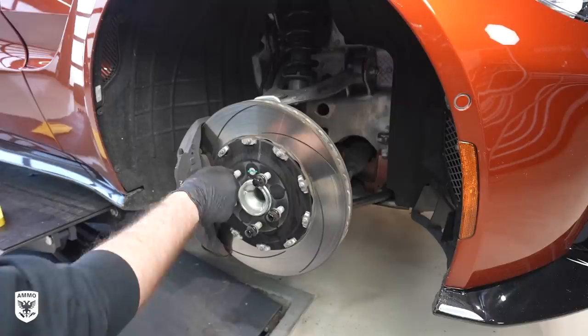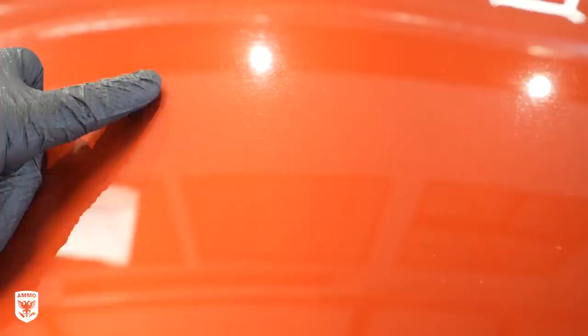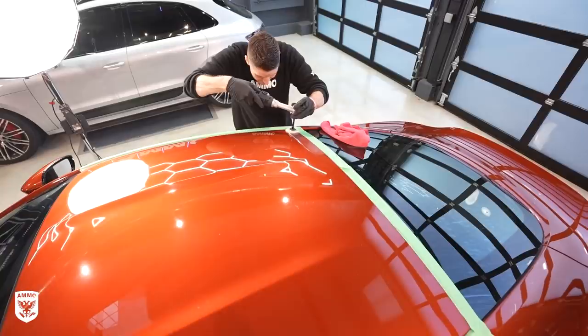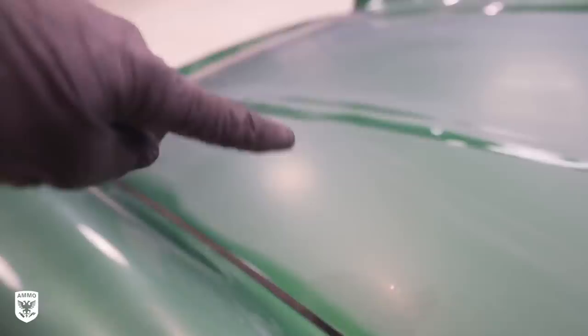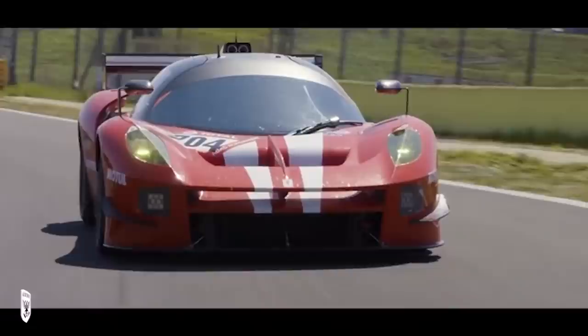As you can see the car has definitely been driven and for an Aston Martin this is pretty dirty, but the main concern is that the paint itself has leftover sanding marks from the factory. This is typically indicated by pigtails or tick marks around the edges of the panel as you can see right here. Proper edge sanding tends to be the first process left incomplete in high volume OEM manufacturing. Pagani, Bugatti, Koenigsegg and hopefully Glickenhaus are among the rare few exceptions with above average paint directly from the factory.